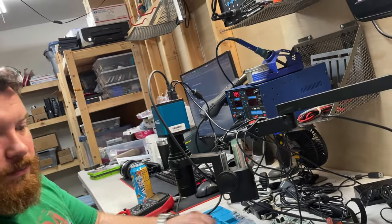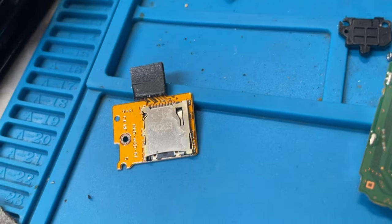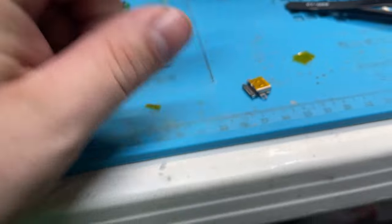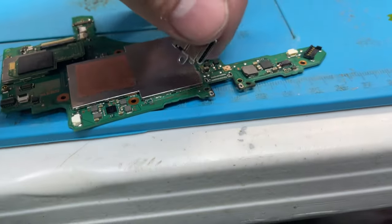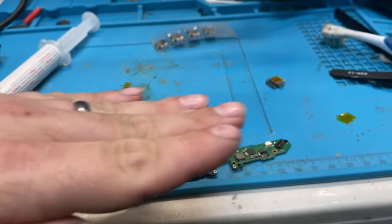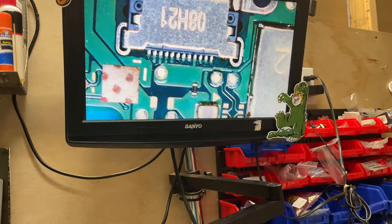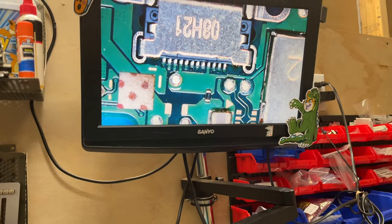The sticky stuff I was referring to is on the SD port - it's got some weird residue on it. Looks like someone spilled soda on it or something. The technique I tend to use - I normally burn these - I saw someone use a different approach where you put tape on the bottom and feed it in there, heat it up, and hopefully it solders down when it goes vertical. We tried the technique and these ones are all soldered on pretty well. It's always the ones right in the middle that aren't, so hopefully this will let us get them all in one try.